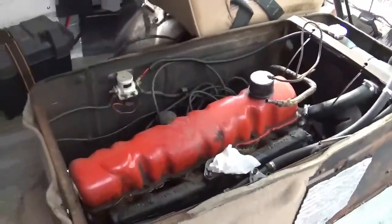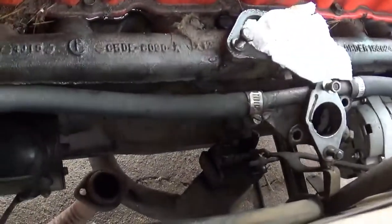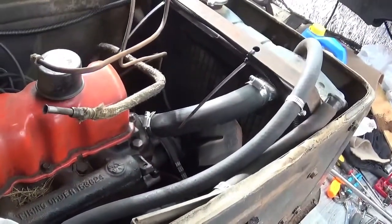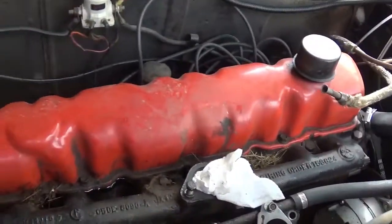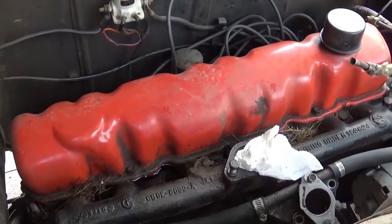You saw before the cover was removed. We worked at the exhaust manifold, and now there's a big hole down there where there's no exhaust manifold. The carburetor was taken off. Started working on removing those heater hoses. They both came off. That is where we're at the moment. My next step, I'm pulling that valve cover off, and then we're going to pull the head bolts out.